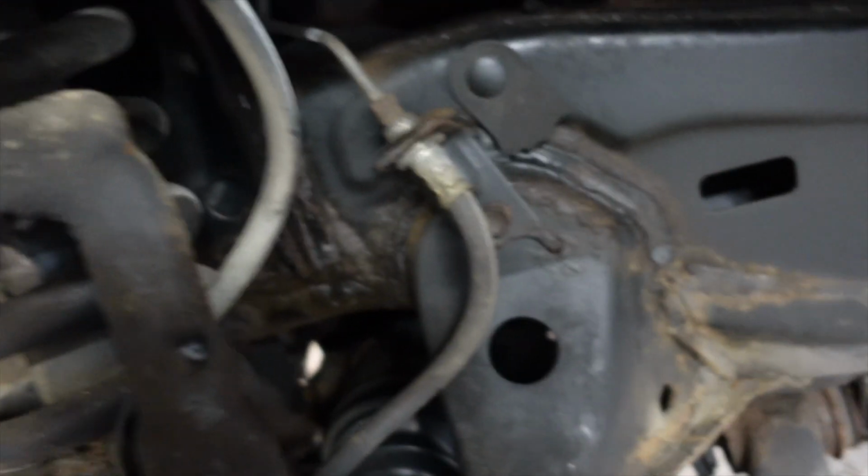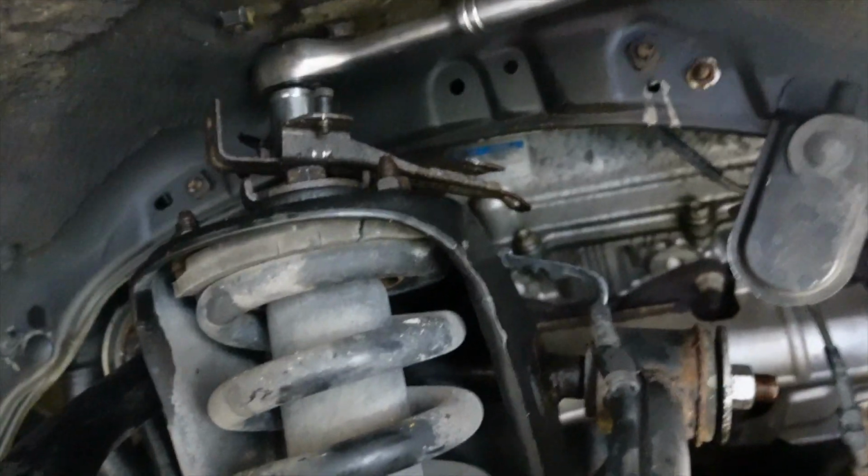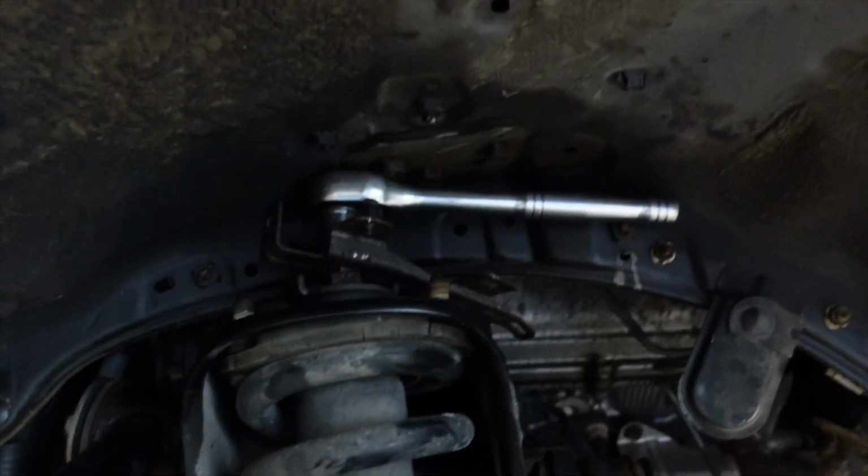All right, so I got this assembly loose, right? But as you can see, the top of my ratchet is now bottoming out on the top of my fender well. So what I'm gonna do is just loosen up these three top hat bolts right here. One, two right here, and then there's one in the back. If you have a ratchet wrench, now would be the time to break it out, because I found a 14mm ratchet wrench to be the best tool for the job here. It makes it super easy to break these. You might have to use something to break the bolts loose first, but once they're broken, ratchet wrench all the way. All right, so got off those 14mm nuts.